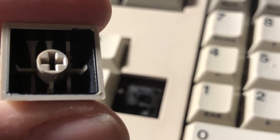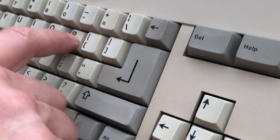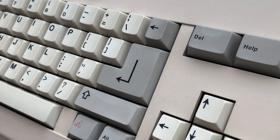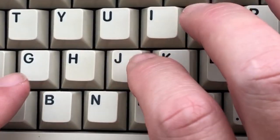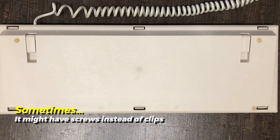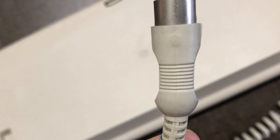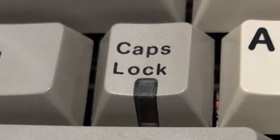Removing the keycaps, we see that this fantastic keyboard has Cherry MX Black switches — similar to those found in Amiga 1000s. These switches are rated to a lifespan of 50 million keystrokes per key. The sound level is rated as quiet with a travel distance of only four millimeters. The keystrokes are often fluid and linear and the feel is nice and heavy. This is a primo Commodore keyboard and one of the finest they ever produced. If you flip the keyboard over, you can see it has six plastic clips around its perimeter. There is no serial number or manufacturing country of origin on the bottom, and the cord's plug is also uniquely shaped — more ergonomic with a somewhat hourglass shape.